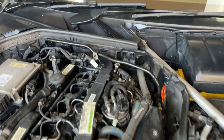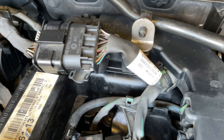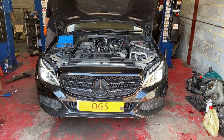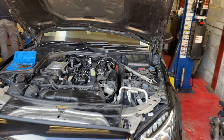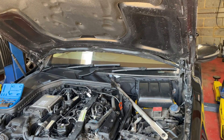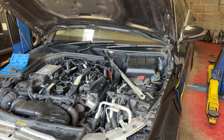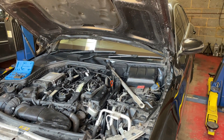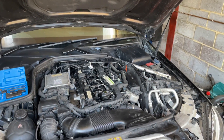This job has now been completed. We serviced the engine, left it overnight, and this will be the first start-up today — we want to pay attention to the engine noise. As can be heard, there is no extra noise on the first start-up; the engine sounded exactly as it was supposed to. This is something you need to pay attention to on the first cold start — the engine could reveal noises that can prevent significant damage. In this case we replaced the timing chain. The first cold start-up is when you're going to hear the engine being noisy for a few seconds and then quiet down — this is a symptom of chain stretch.